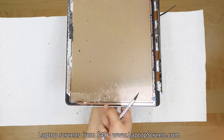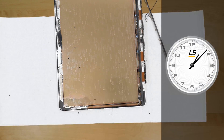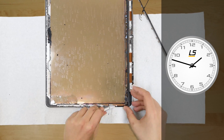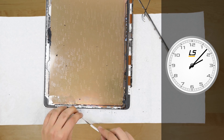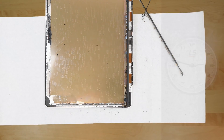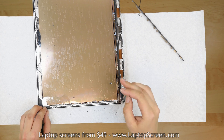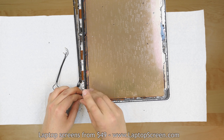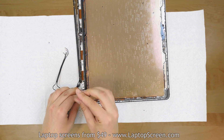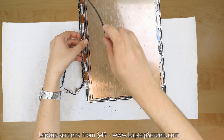There are two distinct perimeters of glue identifiable by black strips under the screen that need to be separated. The entire process of separation may take up to a couple of hours. Two more Phillips screws secure the display positioning guide, located under the silicone covers in each of the bottom corners of the assembly. Remove both screws, then remove the entire back layer of the LCD matrix as one piece.